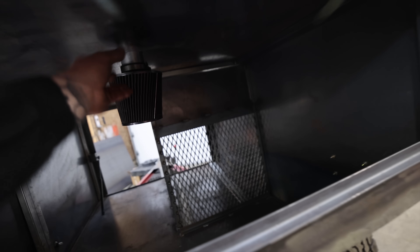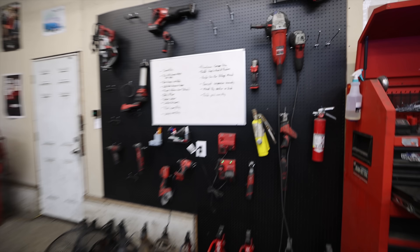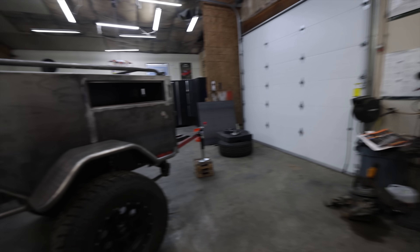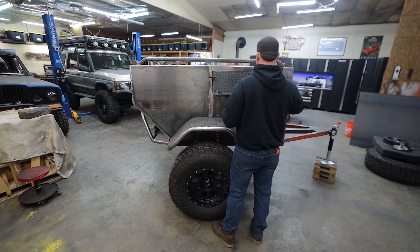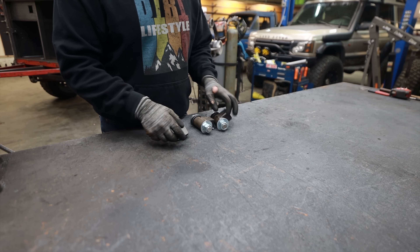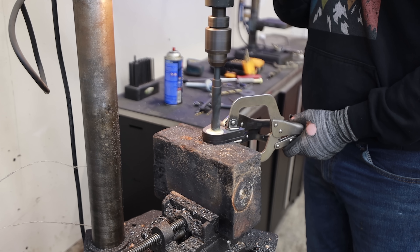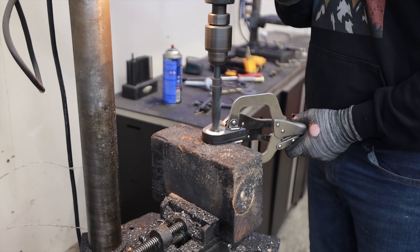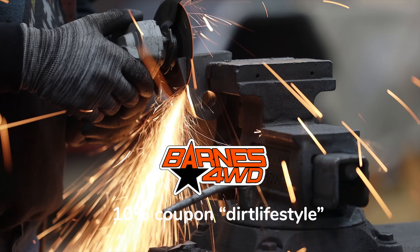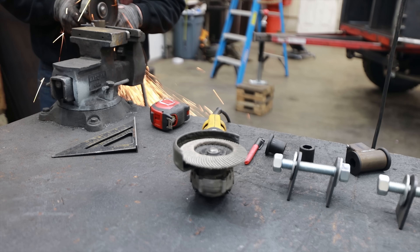This is version 1.0. We might end up routing it over to an airbox that I mount on the side, but at least we have something we can go test in the field. Now I've got this giant list of things to do, and I think the next thing is to get this door mounted finally. To mount this kitchen door, we're going to use some tabs from Barnes 4-Wheel Drive. These come with a 9/16th hole — we need to drill them out to a 3/4-inch hole and trim one side, and they should fit just fine. I'm going to try to repurpose some hinges we originally had for the kitchen door. Hopefully with a little trimming and creativity, we can make these work for our new application.